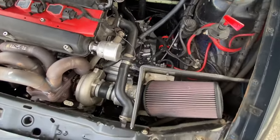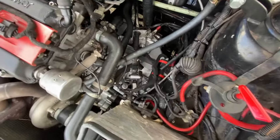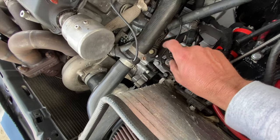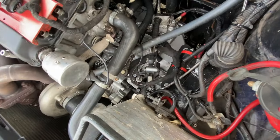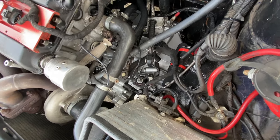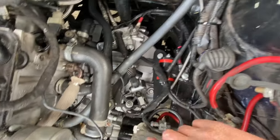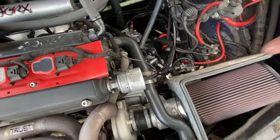This is where the magic is — this is still a manual shift, non-DSG Audi TT gearbox. If you look at this bolt here, it doesn't actually go through the gearbox; that bolts to the block, and then the gearbox bolts through the adapter plate with a spacer. I would feel there's maybe a custom flywheel in there, or maybe a spacer off the crank end to the flywheel to take up that little bit of space. If you look down the back there's the transfer box, and again it's on VW shafts — so I would have thought custom drive shafts.